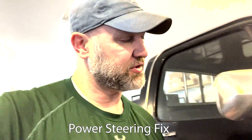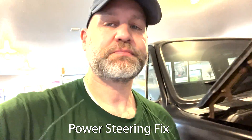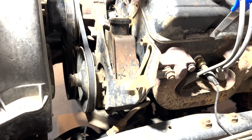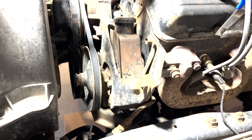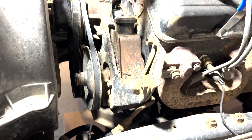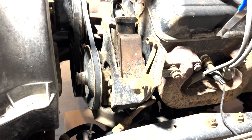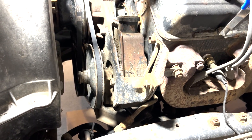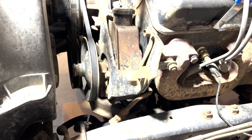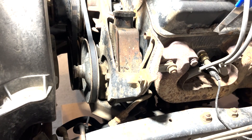We get to work. We've done a couple things on the truck to improve it this winter, but we're going to tackle one of the things that's annoyed me since I've started driving this again — the power steering pump. That's the old power steering pump. What tends to happen is when you're driving it drives just fine, but then when you try to go left or right in a short turn radius, she just squeals. So we've got to take that off, bleed the system, and install a new one.